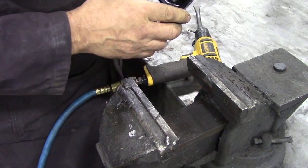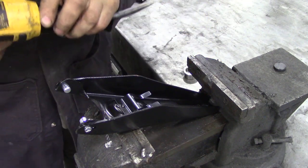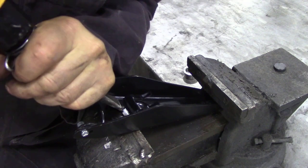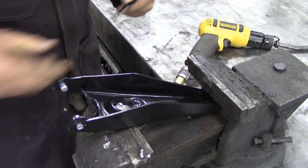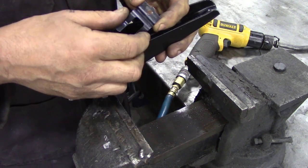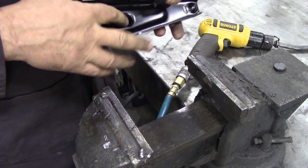I'm going to try and knock that rivet out in one fell swoop. What I usually do is set my vice up like that and then use the chisel. So we're going to pick up the chisel, force it in — and there she goes, she's off. You can drill it, you can chisel it, whichever way you want, but you've got to get it off. You don't want to damage the little fork — it doesn't matter so much if the little tang gets broken, as long as it goes back in place.